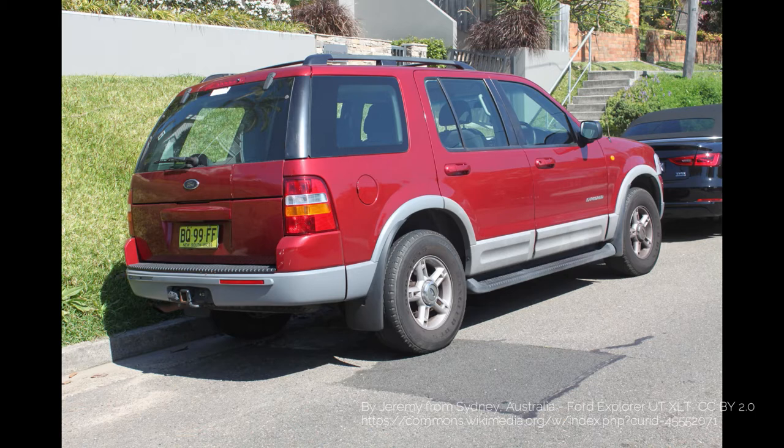You can see in this picture the panel is cracked to the right of the Ford emblem. The panel can be purchased from Ford and painted to match, or you can buy a pre-painted panel from Dorman for just a little more than $100. The Explorer in my shop had a more advanced problem. Once that crack has developed, water will begin to collect inside that panel. At the bottom of that panel is a striker for the hatch, and it's made of ordinary steel. Steel plus water plus time equals rust, and the one in my shop had rusted through the studs that kept the striker plate attached to the glass.